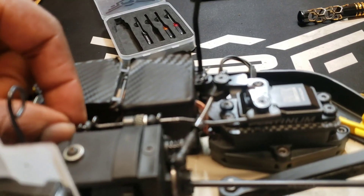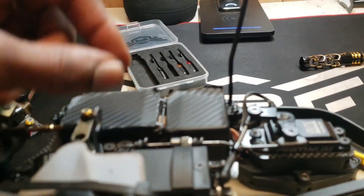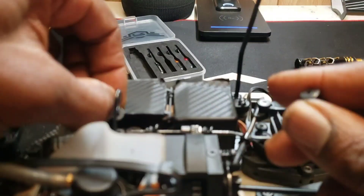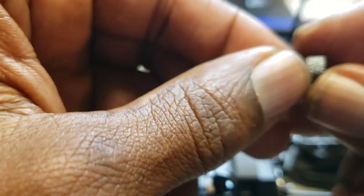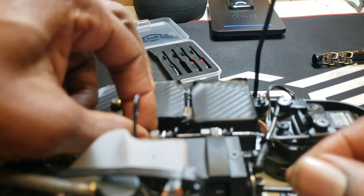I got that through the little linkage hole right there. So now I got the black little washer on. Now I'm going to put the silver washer. And now the adjustable grommet goes on last. You want the screw part to go on first because that gives you the extra tension you may need to adjust it out later.